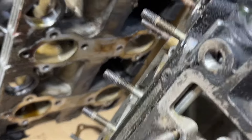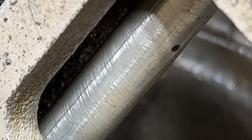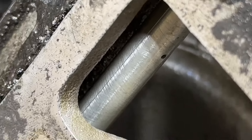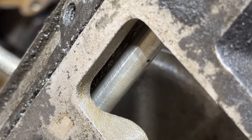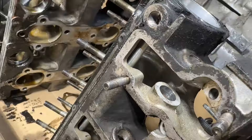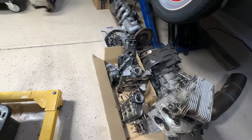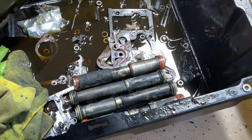Let me show you that real quick. So this squirter right there — there's a pinhole. See that pinhole? That pinhole gets plugged with the silicone. That is the problem. Then if that gets plugged, now you've got the cam and the rockers without oil, getting hot — and that's when they start heating up. I've seen this on the 3.6 that we just turned into a 3.8. So that's why all that silicone on the return tubes scares me.